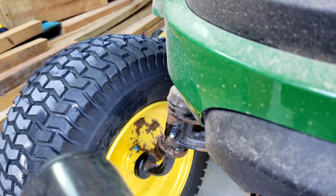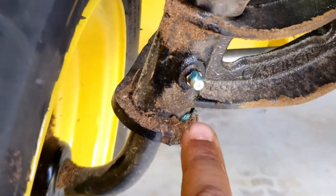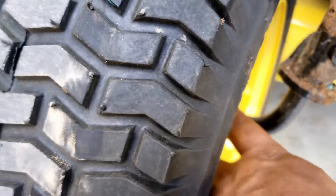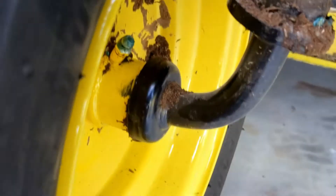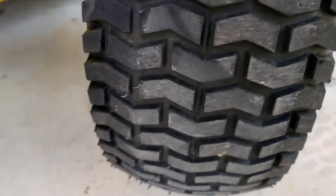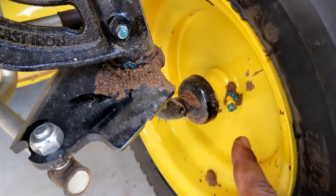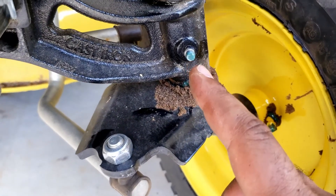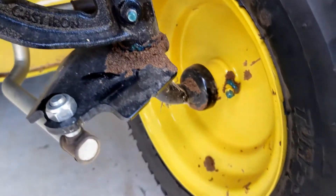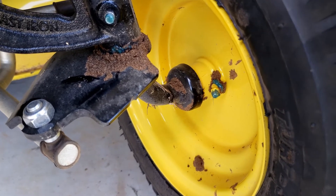That seems like a lot of trouble. You see how it's coming out right here on the bottom, and then this guy here — there's a tiny little overflow in the back here that you can see. We'll check out the other side. I had to put you guys on pause for a second to turn the wheel. Here you can see the fitting and it's bubbling out right behind it. I know I'm good and packed. I'll turn the wheel a couple of times just to spread that grease around in there, but it should be good.